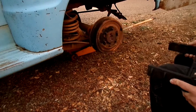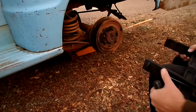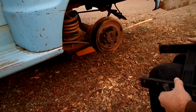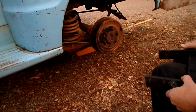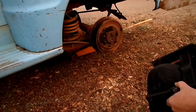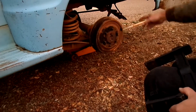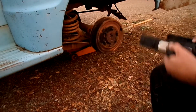I was working on a car that had actually been sitting partially in a flood. It's past the axles in water. The rear drums are just rusted on there. And so the first one I did the old way, backing the star adjuster off and prying around the drum and beating on it and prying on it. Took forever. Of course, I nicked the drum up. I said, I'm done with that.